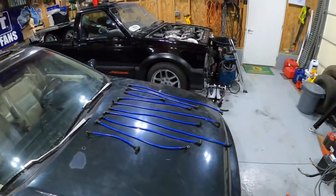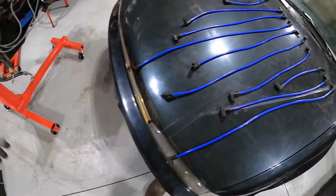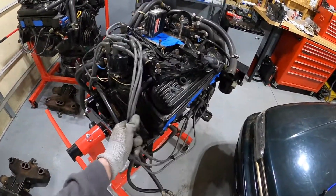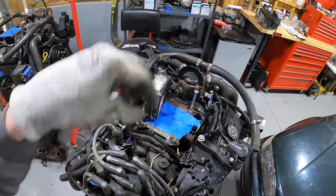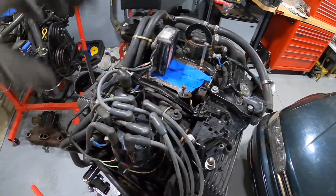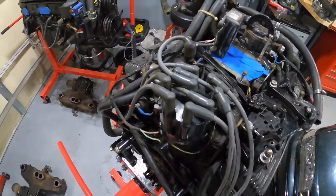The hood makes an incredible table. I like to lay all my cables out so I know what length they are and can match them up easier with the old cables. Right now I'm going to take the new distributor cap, place it right here, and transfer over each individual wire so it's all set up correctly, then get that cap bolted down after I replace the rotor and internals. I'll show you that.